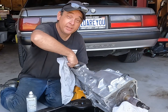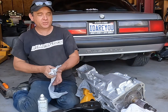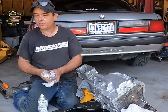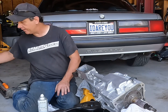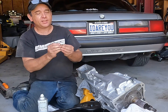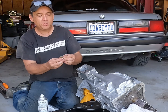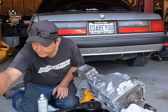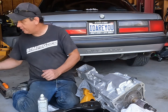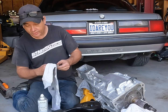As with anything you're doing, you want it to be super clean. So this transmission is supposed to have about 63,000 kilometers on it. I got it off somebody that I trust. Unfortunately for us, the bushing in it has got a bit of a rash mark there. That probably wouldn't be a problem, but I'm not going to use it. I'm going to use the one out of the transmission we just broke because it looks to be in excellent shape.